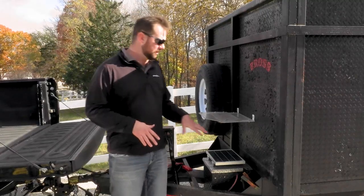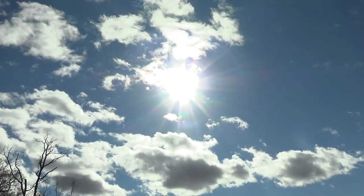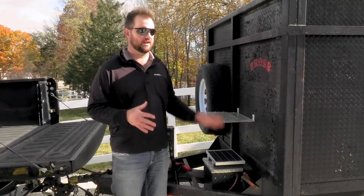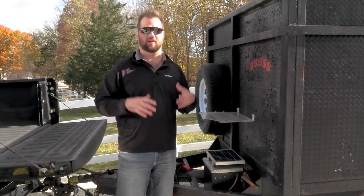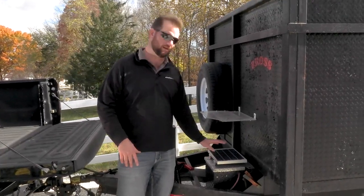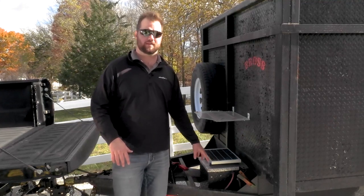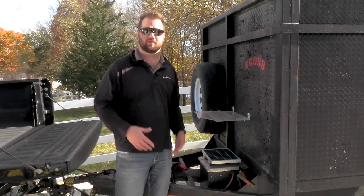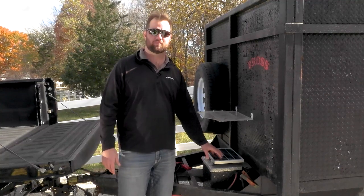On the topic of solar panels — solar panels or solar battery boxes are going to be a great option for storage. By storage I don't just mean the long months you're not using it; even if you're not using your dump trailer for a couple of weeks, a solar panel is going to provide a small amount of amperage from the sun and add that charge to your battery while you're not using your trailer. This gives people a lot of peace of mind that your trailer is going to be ready and charged up whenever you need it. One thing to note: check the fuse every now and then to make sure it's not blown so that your solar panel continues to charge your battery.